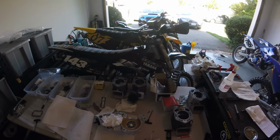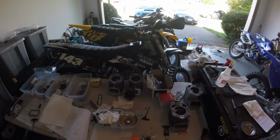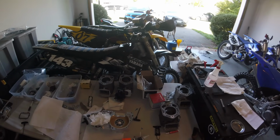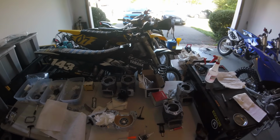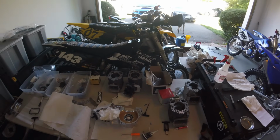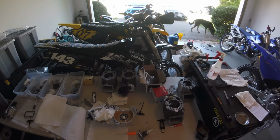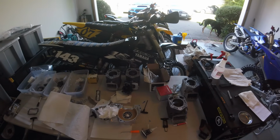However, most of the modern theory has been centered around 125 cc GP engines, and this being a very large displacement engine, I think that the smaller volume may actually be beneficial. In simulation, the smaller crankcase volume ended up gaining about 2 horsepower over unstuffed. So having these stuffers allows me to vary that ratio without having to significantly machine or redesign the cases, which is awesome. Now, the only drawback is they're kind of a pain in the ass to make work correctly.